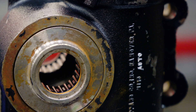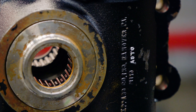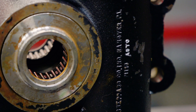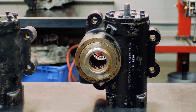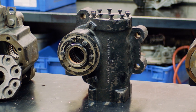The auto style will be indicated by the housing casting. These gears will most likely use the L seal style kit, whereas the manual style will use the standard complete gear seal kit. You can also tell after disassembly — the L seal style gears have a groove on the housing, whereas the O-ring or standard style have a groove on the bearing carrier.